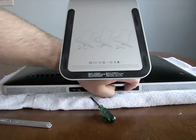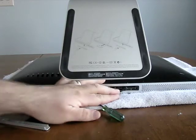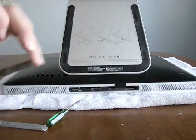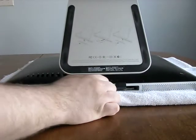So there's these little flaps. There's this little plastic piece right here. We're going to grab that and pull, and that will snap the memory module out of place. And there we have it — there's the old one. We'll move that over. That's Hynix. We'll do the same here.